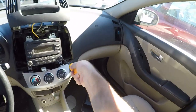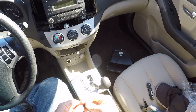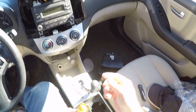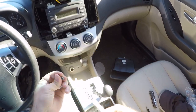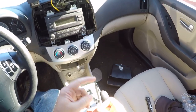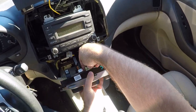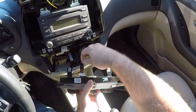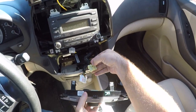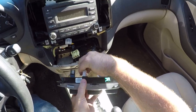One there. See how good that screwdriver bit — the tip bit into the screw? I just went to pull the screw off and the screw stuck to the tip. This is not the tip that came with the Snap-on — this is actually a Craftsman bit. It's a P2R, it's a round Phillips. That's your pro tip for the day. A P2R is way better than a regular Phillips. They're rounded instead of pointy — they don't wear out as quick and they grip the screws really well. So there's your two plugs: the yellow one — I just pushed down on the top tab — and the white one, I pushed in on the side tab and pulled that out.